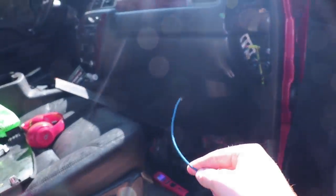All right, we're finally back to some sunshine a couple minutes later. We've got to find ourselves a remote wire — meaning this wire. When 12 volts gets sent to it, it's going to act as a relay in the amp. It just needs 12 volts and it'll kick the relay in the amp and send 12 volts from the battery to the amp. The gauge of this wire you're going to tap into doesn't exactly matter because you just need the voltage to pretty much tell the amp to send it from the battery. This wire has no draw — it's just telling the amp to kick on. When it's not there, it's off.